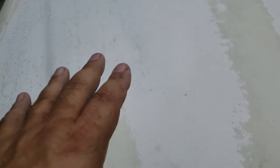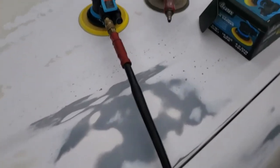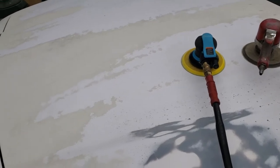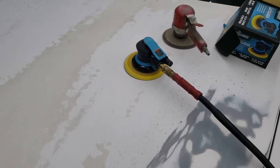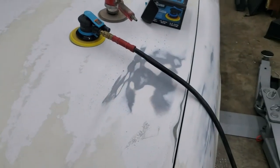Sometimes when you lay too many coats on and you don't let it flash between coats, it traps solvent that's trying to get out — it's called solvent popping. It looks like zits all over the place, and you see the clear delaminated off. This was a fleet vehicle and they did what's called a quickie flickie. I'm bringing it back — I'm going to DA her down as well as I can. Then I'm using a product made by Evercoat — same people that make Feather Fill — I think it's called four-to-one. It's a polyester primer, high build, but it's also a hybrid that can be shot over bare metal, because I know I'm going to have a lot of bare metal in different places.